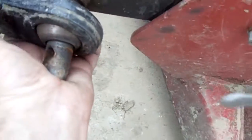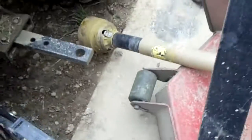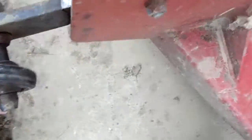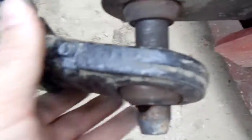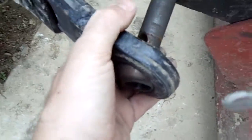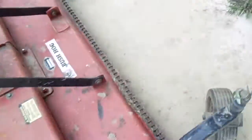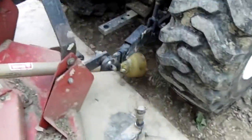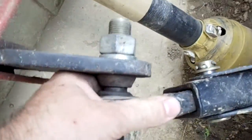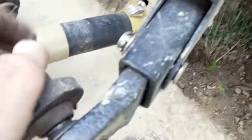These might be a little tight on there and with this thing being up snug to the tractor it takes a little fiddle sometimes. Here's the important part on this tractor — if you kick down on this with your foot like so, it actually releases these end pieces and they can flex out. See how it flexed out? Now it gives me the extra length I need to roll that off of there. You do the same thing over here — just take your foot, slam it down like so, and that'll loosen that up and allows you to drag this end out.